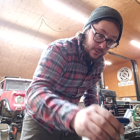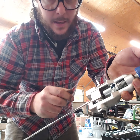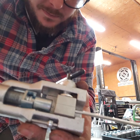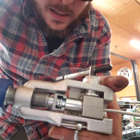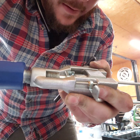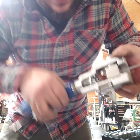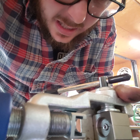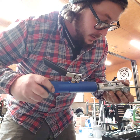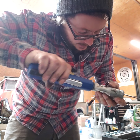Then we're going to select the dies. We're going to need this cone — that's the last step. And the first step is this little guy, the 3/16th die. Flip that over, put it in there. You just tighten this down and then you pump — I'm pumping the handle. This is stainless steel too, and if you've ever tried to hand flare stainless, you know how next to impossible it is. There's the first step. You can see it's pushed the first flare down in there. You can actually turn to get it back to wherever you need to if the dies are too short or too long. Then you go on with the cone — this is going to finish the flare.